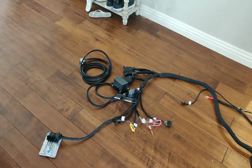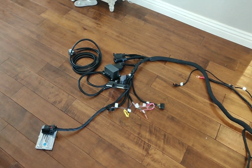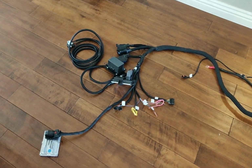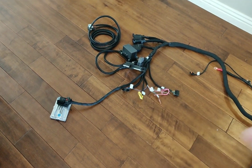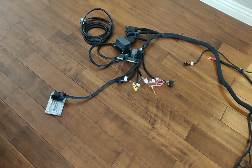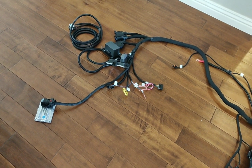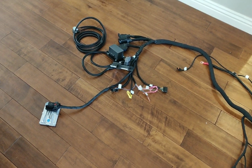It's a bypass valve at 75 pounds of pressure. When I tested on a standard in-tank pump, like an Aeromotive pump, it would spike up to like 100 pounds of pressure and would mess everything up. So what I found out is this module is doing the best it can, but it's such a quick change. When you go wide open throttle, it's going to take a little bit of time for it to build that pressure, and it sends max voltage to your pump to make that pressure. Well, it sends max voltage, and then you don't have a regulator in your system. It will hit 100 pounds of pressure. It then sees that, kills a bunch of power to your fuel pump to pull that pressure back down, and now your fuel pressure is going crazy.